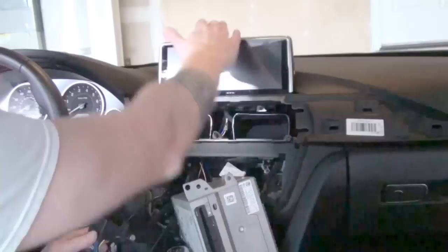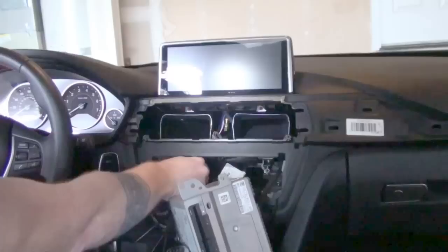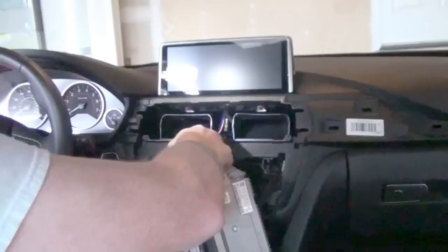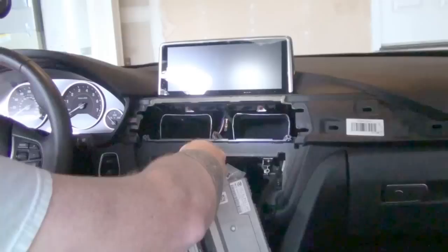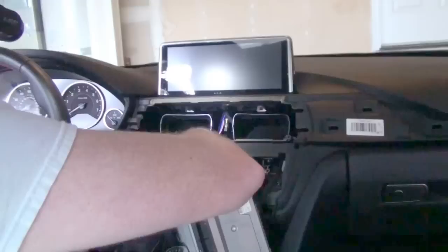The display is in place. I'm not going to screw it in right now. All of my cables are down in neat order, all of my additional cables are down, and my vents are clear. Now I'm going to connect — this is the original wiring harness plug, and this is that Y adapter to give us all the additional connectivity and all the other functions. This can only go one way — you've got this collar, so you walk that collar back, put the plug in, and walk the collar forward.